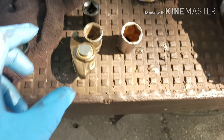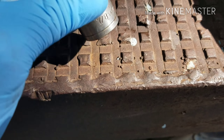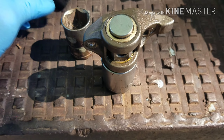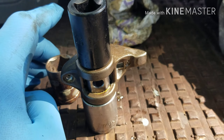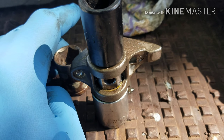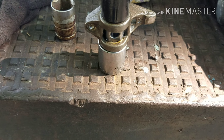We're talking about a trunnion upgrade for LS rocker arms. I'm not making a long video. The factory ones got these little bearings in them that sit inside the cup. On big duration, big lift — lift or fail — a bearing will fall off in your engine and you got a big problem.